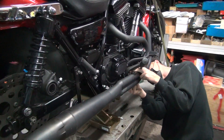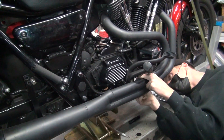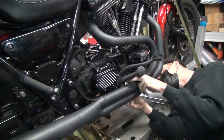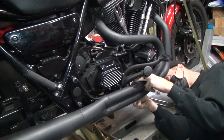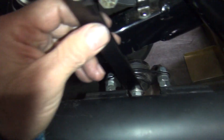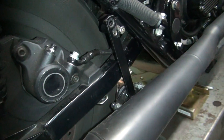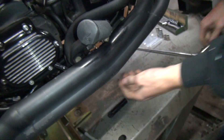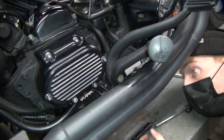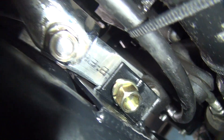Just a Thunder Header we're putting on a bike. This is the bracket they come with on the back here. Looks like your lower hole is lining up again over here. All seems to go in there good and even. You got access to get a socket under there? Not from this side — I have to get an open end. I can't do a socket at all on it. Looks like there's enough room even on the real one.